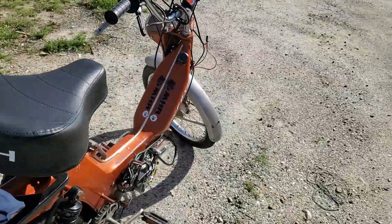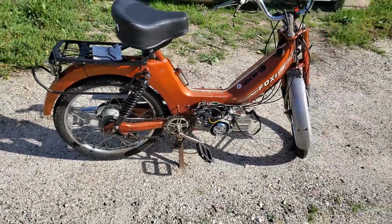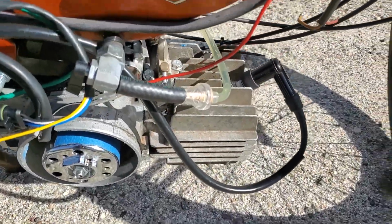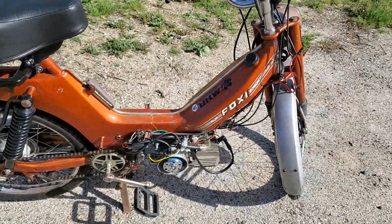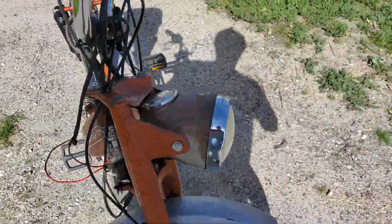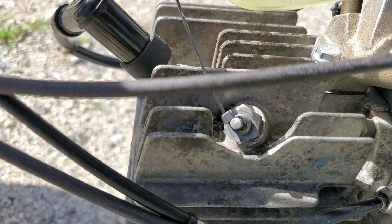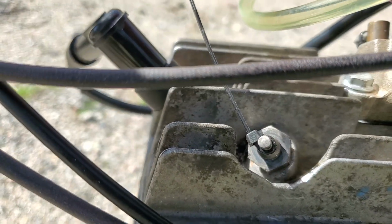That air leak, I was not convinced, I thought it was a manifold. I went and tightened the nuts on the jug. They weren't loose, but they could afford to be tightened, and yet the bike ran worse. Well, probably it ran worse because the little plunger part of the compression release was sliding down there, letting a lot of air in.